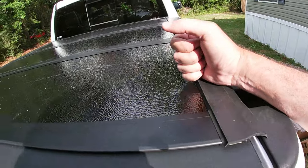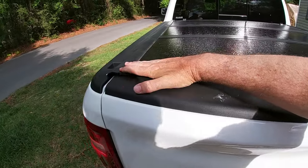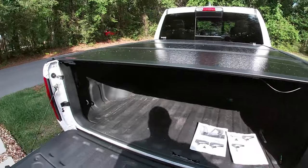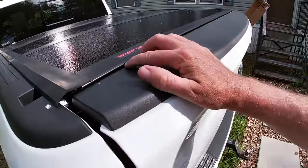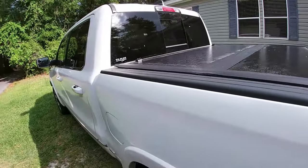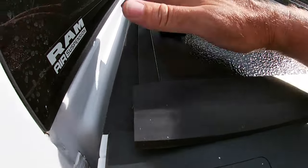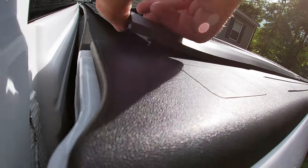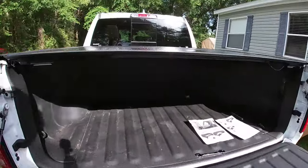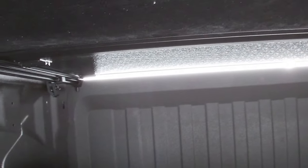Close your tailgate, then right where that clamp is, give it a couple of whacks and it will level itself to your tailgate. Then pop it open, tighten up that bolt, and it should be nice and level. You just want a little bit of the tailgate to go under there — you don't need it sticking all the way back. You can see there's a gap under there if you go inside the bed — you should be able to see the light gap.